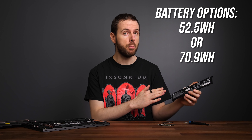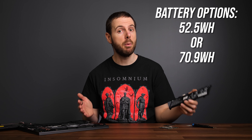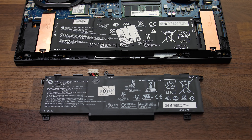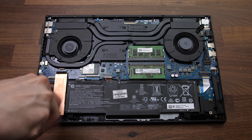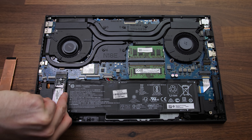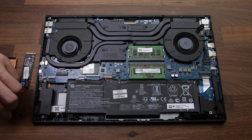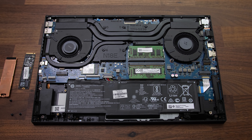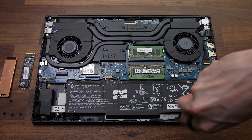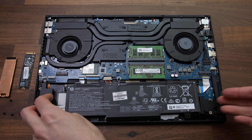Let's check out the battery next. The Omen 15 is either available with a smaller 52.5Wh battery or a larger 70.9Wh battery, and both take up the same amount of space physically, so if you have the smaller one you can buy the larger one from HP — links are in the description. To take out the old battery we need to remove 5 Phillips head screws. One of them is hiding under the M.2 drive on the left, so we have to take out the SSD to remove the battery — a little annoying but nothing too difficult. I removed the battery cable from the laptop using my fingernails on both the left and right side of the cable at the same time and pulling, but you could try plastic pry tools if it's stuck.